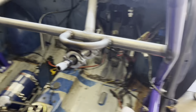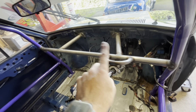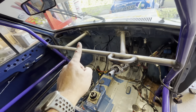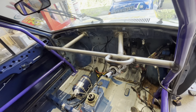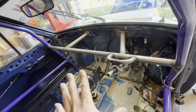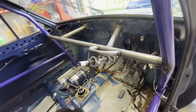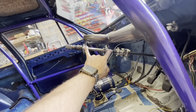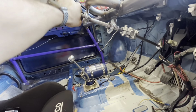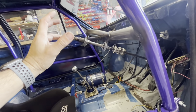We built a frame, so we've got CDS tubing. Because this is a bolted cage and pretty rudimentary, we plated the bulkhead and then inserted these two tubes at a slight angle just to add a little bit more strength to what is quite a weak cage. So now that is helping hold the rest of the cage where it should be. We then have a little D-ring which holds the plate for the bearings. Because these are so close together, there is no play in this at all - no play in the rack because it's got a custom rack, and there is literally no left-to-right or up-and-down movement. This is so positive, it's unbelievable.